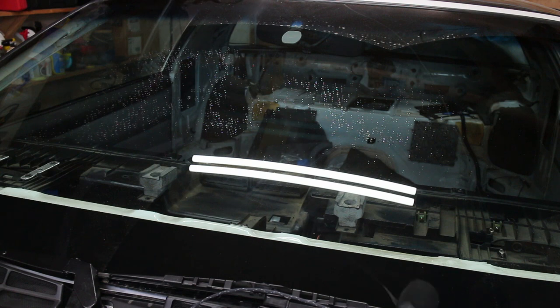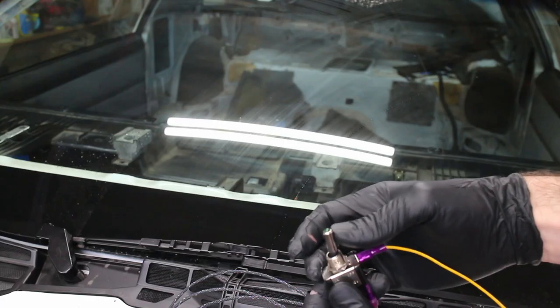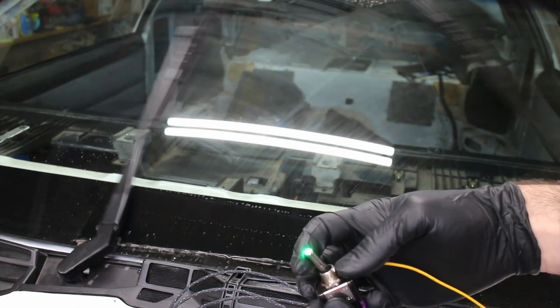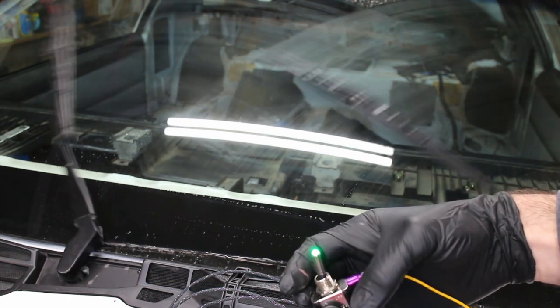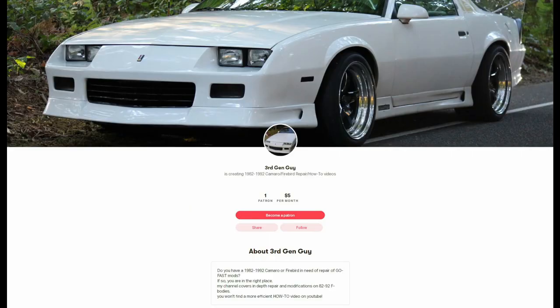I don't have a battery connected to my car, so this rectifier takes its place. Some water on the windshield keeps the motor from working too hard. And bam — we have wipers that work on low and park off of a single toggle switch. As a review, this is the wiring diagram that I used. I hope this was clear — it's always very difficult to explain wiring in videos like this. If you found this video helpful, please consider supporting me on Patreon and don't forget to follow me on Instagram.